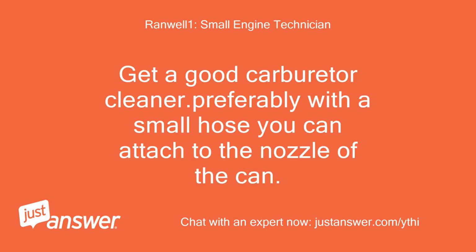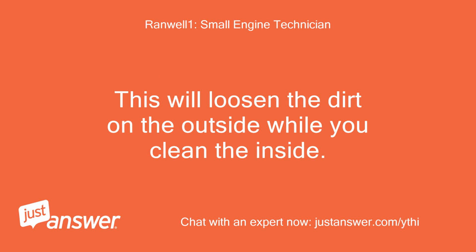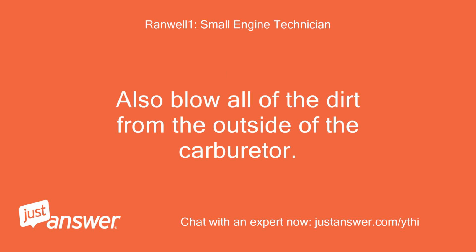Get a good carburetor cleaner, preferably with a small hose you can attach to the nozzle of the can. Spray the carburetor cleaner all over the outside of the carburetor. This will loosen the dirt on the outside while you clean the inside. Now spray the cleaner through every hole and nook and cranny you can find on the inside of the carburetor. When you are finished with the spray, blow all of the passageways clean with compressed air from an air compressor. Also blow all of the dirt from the outside of the carburetor.